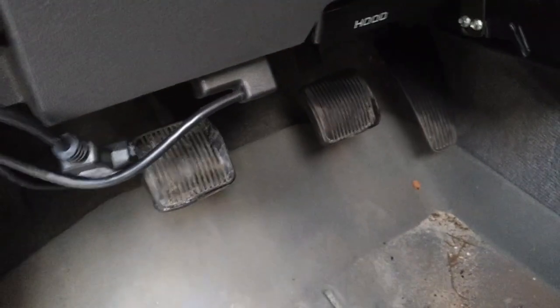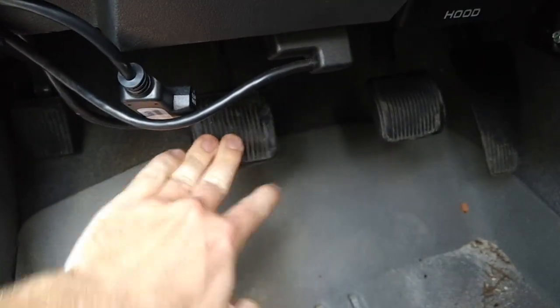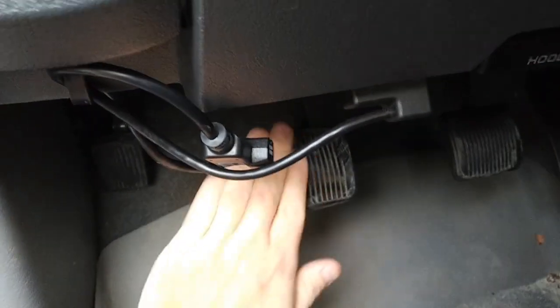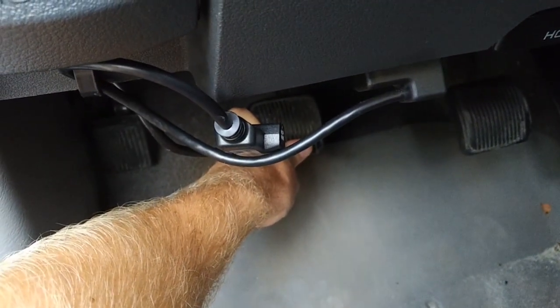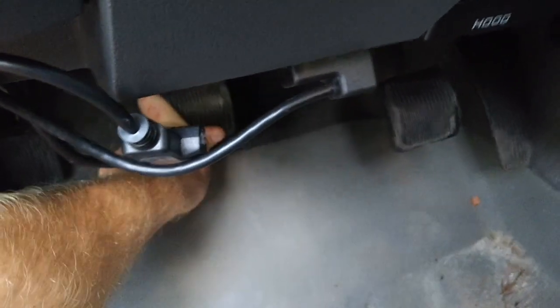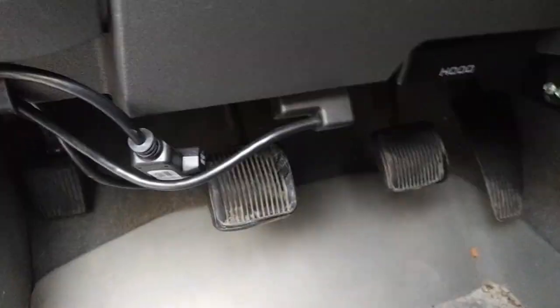Let's come down to the pedal first. So this is fixed right now. There's a little bit of travel there with not much force. But before, it would travel probably to the halfway point before it really developed any force. And you didn't really get real firm until the last about 1/2 to 3/4 of an inch. Maybe the last inch or so.